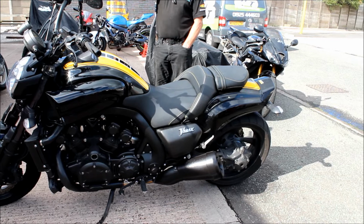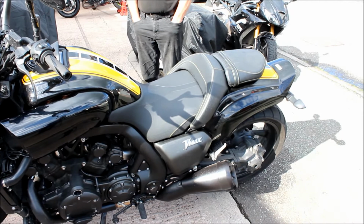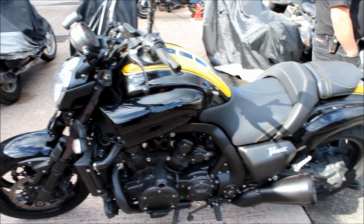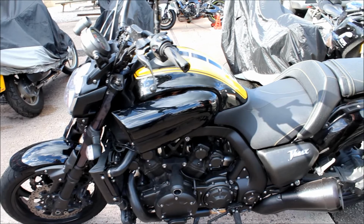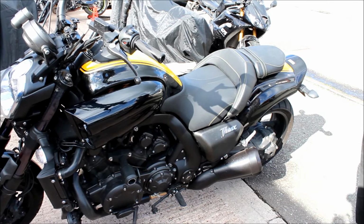It's had the pair valve system blocked off. We've just fitted a Power Commander because the actual map that he got from America wasn't quite right, so we've fitted it to top and tail it. He's also going to use a fogger on it, fogging into the air box. So he wants the Power Commander so that it can switch maps to a nitrous-oriented map, which we've got to work out, because it needs more fuel. He wants the Power Commander to switch a map when his throttle position sensor tells it he's at 100% throttle. So we've just got to work that out electronically.